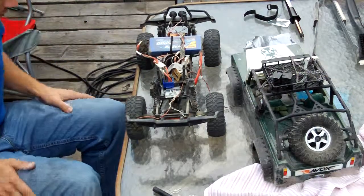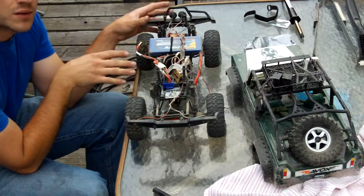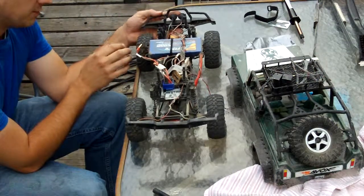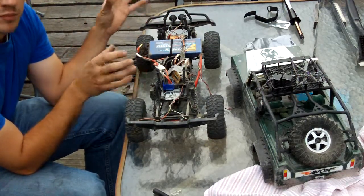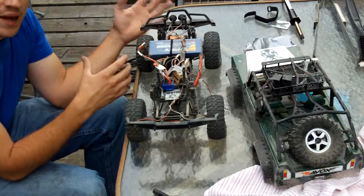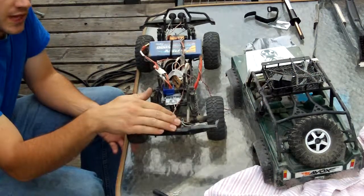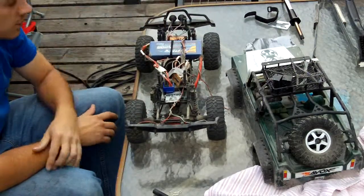Yeah. So you want to get a lot of weight if you're climbing and going downhill, looking for some traction. You want some more weight, not a lot, but most of it towards the front. I'm running a stiff front end right now because of the terrain I was going through, deep, loose soil. Just needed to keep that front bumper from digging down and getting caught. Just let the tires work themselves out. Same with the rear. It's not as taut. It does have some give there, but the front is quite a bit more.